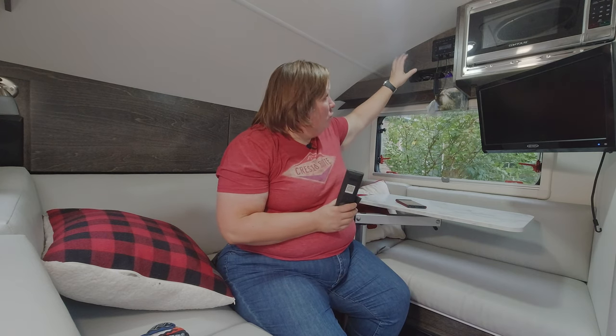When you use your remotes for the TV and for the stereo, there's one button that's critical to both watching what you want and getting sound through the speakers — that's the source button. On the TV, you're selecting your source of what you're watching. If it's just TV over-the-air channels, you'll want to use TV as your source. If you're using something on a USB stick, choose USB. If you're using something plugged into the HDMI outlet on the Jensen Cube, choose HDMI. For your audio on the Jensen Cube, the source gives you options for radio, Bluetooth, auxiliary in, and HDMI. For TV, you'll want to choose auxiliary in. If you're using the HDMI outlet, choose HDMI. If you're using audio from your phone, choose BT mode or Bluetooth.